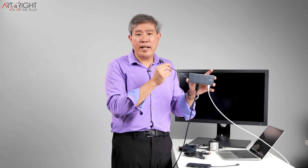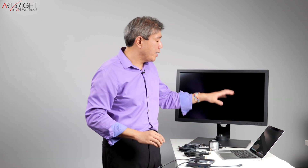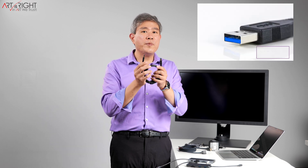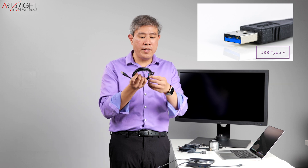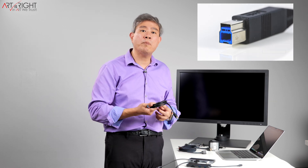If I plug this into my M1 computer right now and try to run the calibration, it won't work. Palette Master Element will give an FTDI error or tell you to plug in your USB port between the DisplayPort and the computer. That's because the hub is only providing the DisplayPort signal — there's no USB signal cable going between the hub and the display. So we need to provide that communication using the USB 3 Type-A to Type-B cable included with all BenQ SW displays. Plug the Type-A into the hub and the Type-B into the uplink port on the SW display, which is on the far right side of the back of the display.